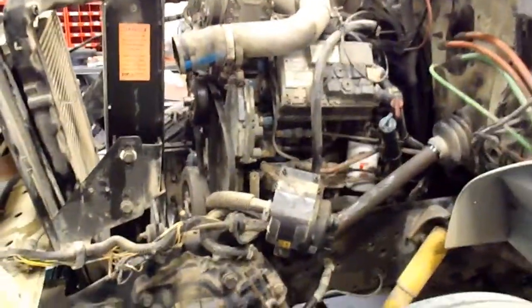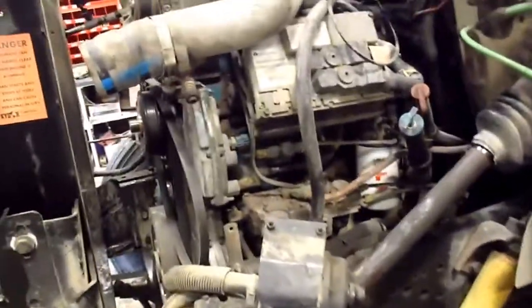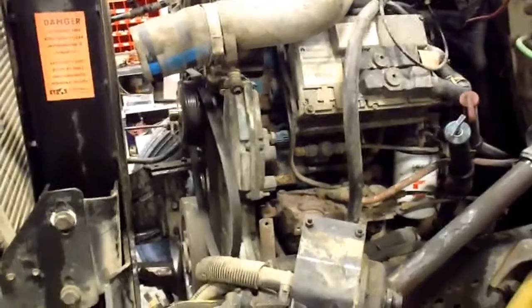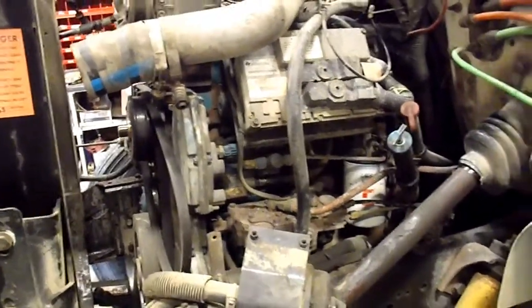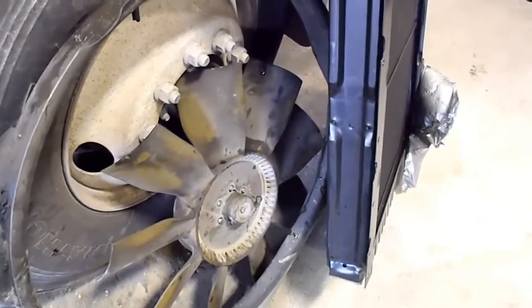So this truck didn't have any overheating issues because of that. It was cooling really good. It's also got extra cooling tubes on it to winterize the water pipes and stuff. The hose reel's still hooked up, and there's coolant too. Just heater hose wrapped around that circulates coolant, so it gets a little auxiliary cooling there too. I'm surprised how much heavier that fan hub is with the air clutch in it. So I have to look at that, play around with that a little bit before I put it back together.